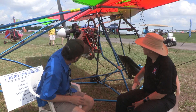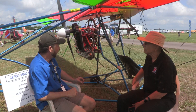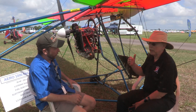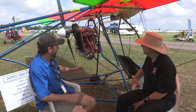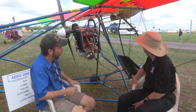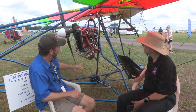Our engine mount here is a very simple six-point mount where the engine has its shock mounts already installed. You almost cannot feel this engine running when you're sitting in the seat. It's a very neat-sounding engine. The exhaust system is adapted from the Enduro bike world in Europe where they have noise restrictions — engines run much quieter there. The base engine is coming out of Italy. The starter uses almost no battery — just a tiny lithium battery weighing maybe a pound. The instrument package is very simple: tach and water temp. That's it. Everything else is monitored by the ECU; if there's an issue, it has a limp mode.